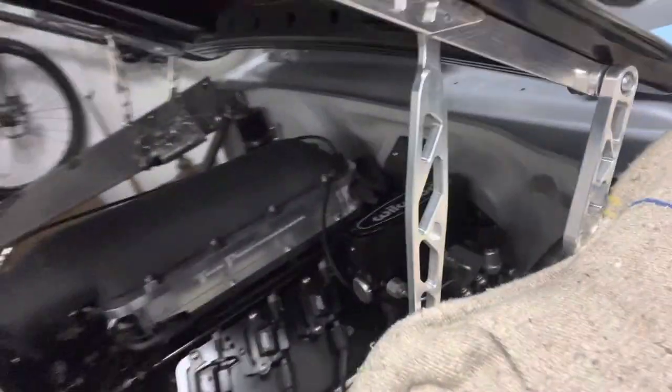I am pulling an all-nighter here. Just finished the brakes — completely redid all of the hard lines in stainless steel. I wasn't happy with my first job in copper-nickel, so I went all stainless with all new fittings and new braided brake hoses that go down from the proportioning valve. Probably about 40 fittings total between all the T's and connections — potential leak points — and probably about 12 of them leaked. Spent quite a bit of time chasing down leaks and tightening things up. Had to redo one of the lines in the back because one of my double flares didn't take the right way. Eventually got it sealed up and the brakes bled.